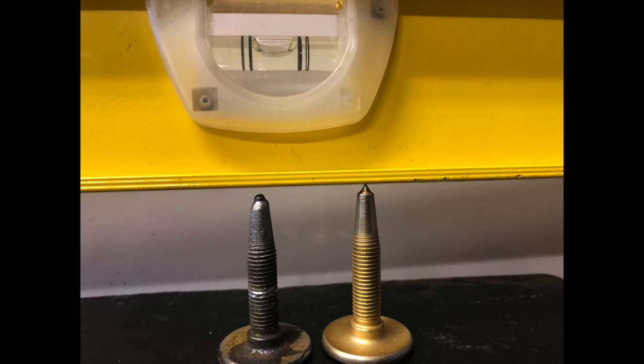So keep in mind, I've got probably about 5,000 kilometers on these studs. And I guess it would probably all depend on the snow conditions you ride in. If you're riding in really good deep snow, they might not wear down as quick. But I rode in probably a lot of low snow conditions, just based on the location I live in, we don't really get a lot of good snow. But just something here you want to check. And obviously the more wore down they are, the less traction you're going to get on the slippery icy corners when you need to slow down, or just traction overall.